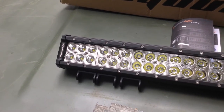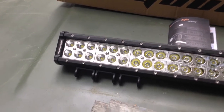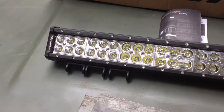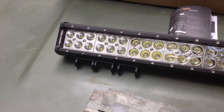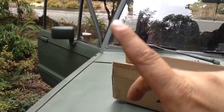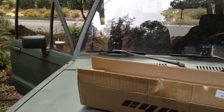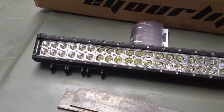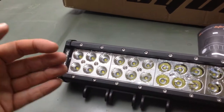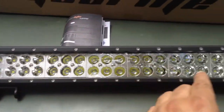I have a handheld spotlight and may install a remote control go-light, though the roof rack still needs to stay flat for the boat. There's also the option of a police-style searchlight bolting into the A-pillar, but the A-pillar on this vehicle is too thin. The ribbed diffusers on the outer LEDs throw more light to the sides by bouncing it back and forth, while the center smooth reflectors make light go straight forward.